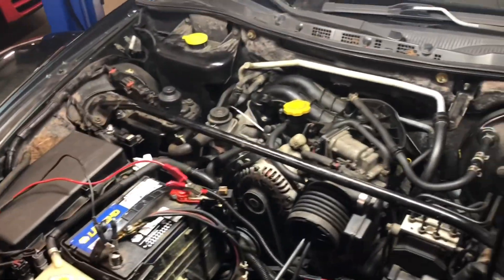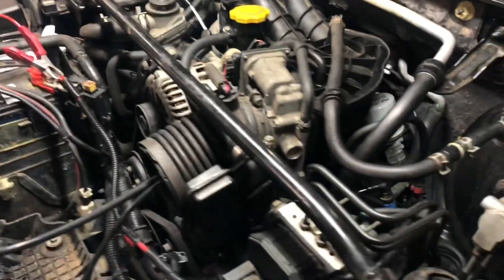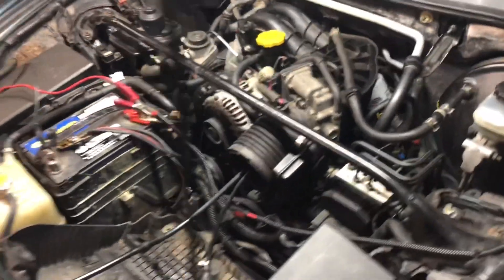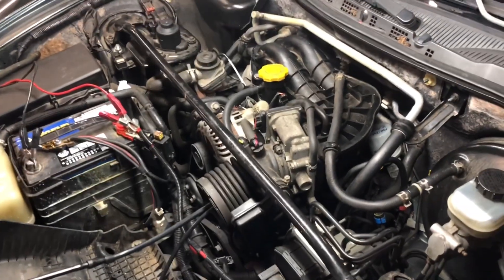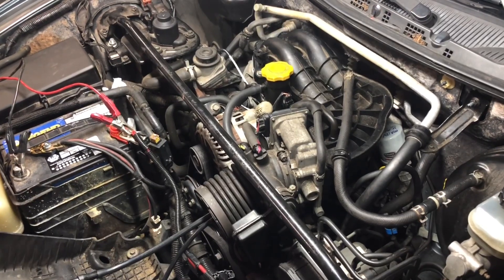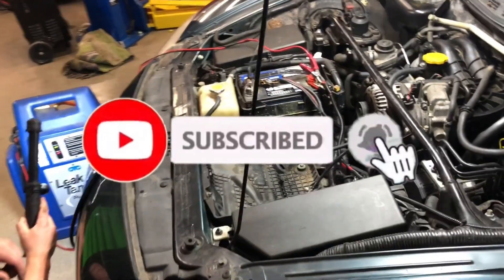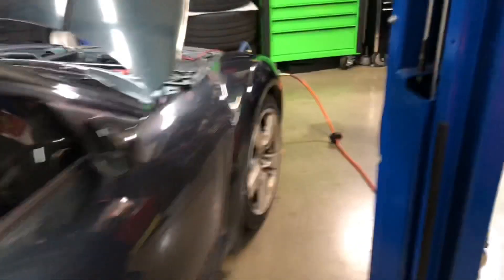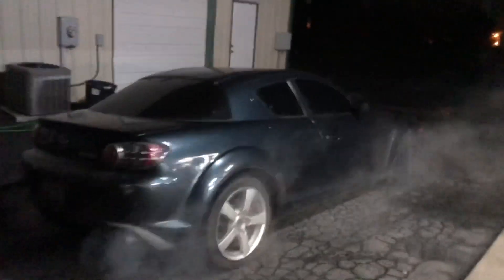Smoke test — and it is not smoking. It means there's no leak in this intake. So it's not losing any smoke. Now I just need to put the airbox back. Wait — maybe I spoke too soon. There are a lot of brittle plastic pipes here. Is it coming out of the tailpipe? Yeah it is — so that's just the tailpipe, not a leak. Okay, so we're done. Let's get the airbox back on. The baby's purring now.